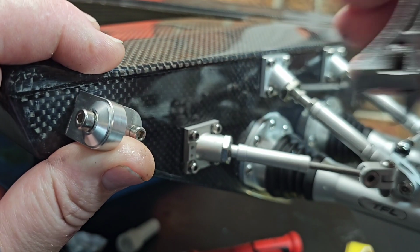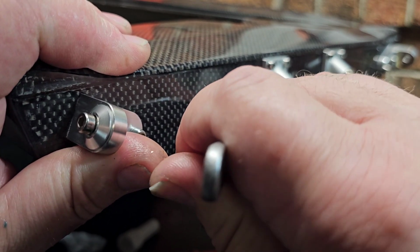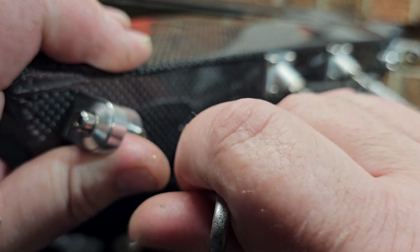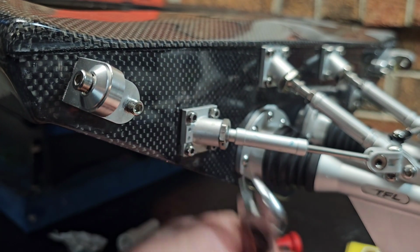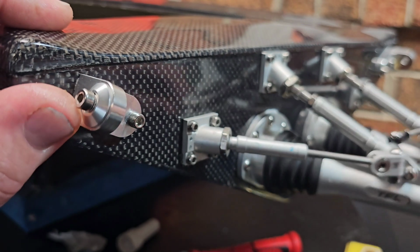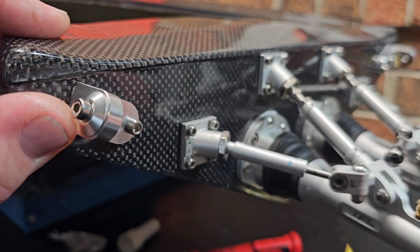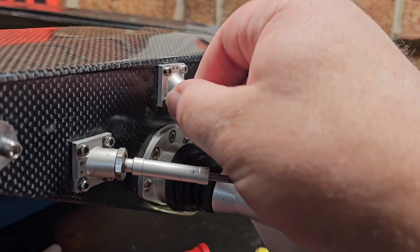Okay, so tighten it all the way. It's actually, I don't feel any resistance in the steering. Actually, I do. So I'm going to back off of it, maybe a third of a turn. Yeah, quarter turn, third of a turn. Yeah, that's good. Okay, so I'm going to basically do that same thing to all of these.